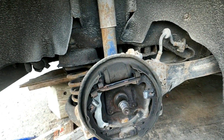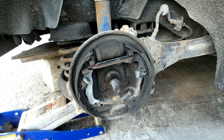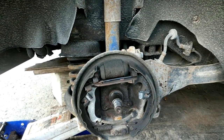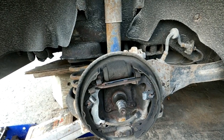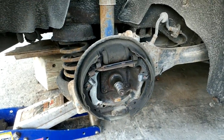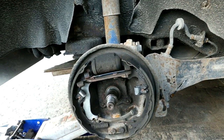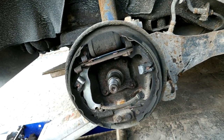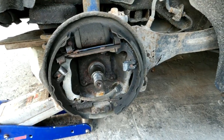It just skids the tire and actually pulls the car to that side — you can feel it squat the back wheel. It's very unusual, I've never seen anything like this. It doesn't seem plausible to me that the other three brakes are to blame — I've got two seized calipers up front and a dud wheel cylinder on the other side, but that doesn't seem probable. I'm stumped — this is the second time I've torn it apart.